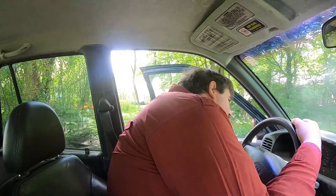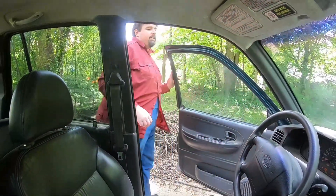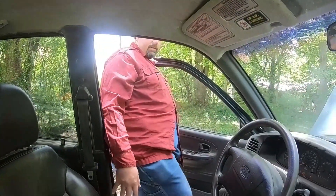Let's see if the fluid level's dropped off. It's possible if the master cylinder has a leak in it, I may have to get it back full of fluid. Let's see if it's using the fluid. The master cylinder seal is still good — well, not necessarily. It's just completely gone. That does normally mean you need a new master cylinder, but sometimes it means that once you fill the void, you have brakes fine. That made the brake light go off. I like how it's telling me there's a brake problem — you pump it up, it gets to minimum pressure so it goes out. Then you let it sit for a moment, hit the brakes, and the brake light comes on telling you there's no brakes. Well, he's just telling you there's a problem, although you would probably know it when you can't stop.